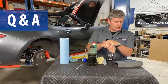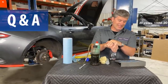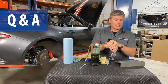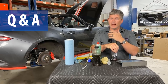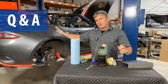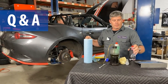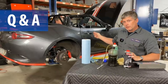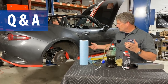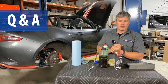The question is: I used a power bleeder and shot air into my rear lines — how long do I bleed to fix this? Basically you keep bleeding until you don't have any more air coming out at the caliper. That's why you start at the one furthest away from the master cylinder — to push the air out that way — and then there's less air in the system for each subsequent wheel, less and less as you go around. One other note: when watching the master cylinder while pumping, the front brakes will move more fluid generally than the rears do, so keep a bigger eye on the reservoir for the front.